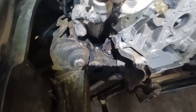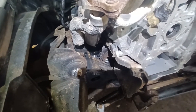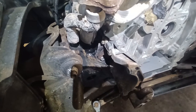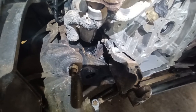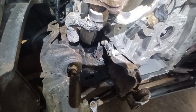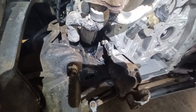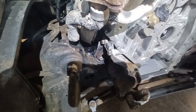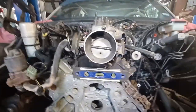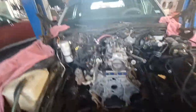Now back to the mounts for just a second - this car had a 4100 Cadillac engine in it. If your car had the 5.7 liter Chevrolet engine with throttle body injection, you can run the engine mount setup that was already on the car. But because this had the 4100, the clamshells on that engine don't match up to small block Chevy clamshells, and the adapter plate I got wouldn't bolt up either, so we had to work around that.